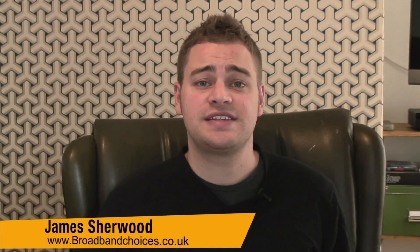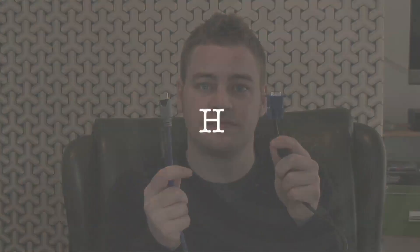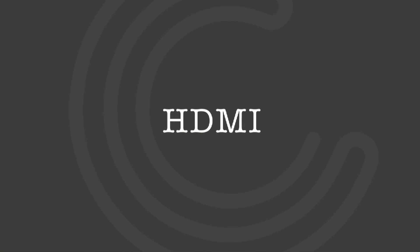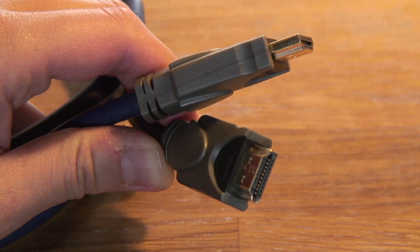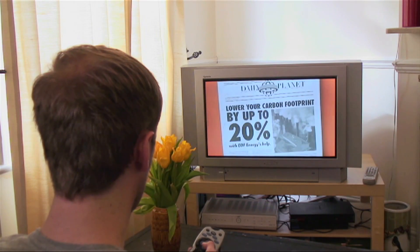What's the best way to connect your PC to your TV? Is it best to use an HDMI cable or a VGA cable like this? HDMI is reputed to give a better picture quality, but that's usually only true if you've got a full HD video source streaming to a full HD TV. In most cases you won't actually notice the difference.